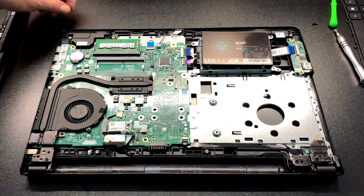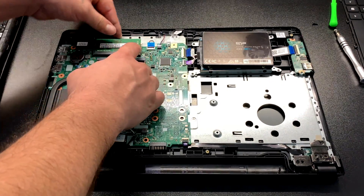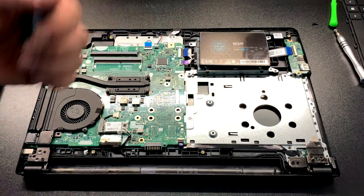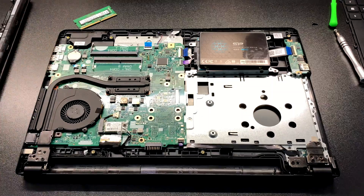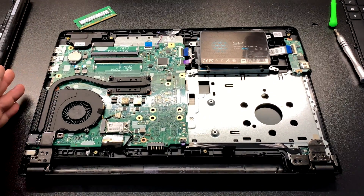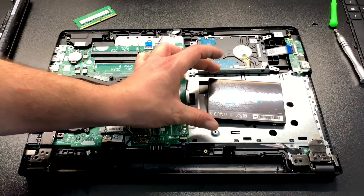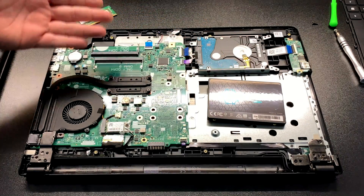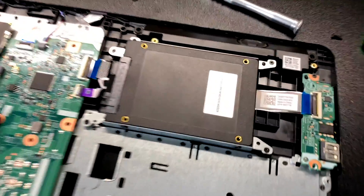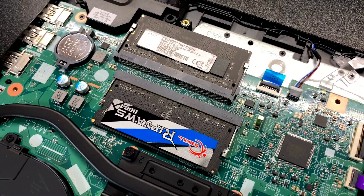For this I'm going to be using a cheap 240 gigabyte SSD that I got on Amazon — I'll leave links in the description. There are two DIMM slots in here but only a single four-gigabyte stick, as I expected. I'm also going to be changing the thermal paste on the heat sink — just going to pull it off, put some Thermal Grizzly on it, and put it all back together. Since this is a newer laptop I would normally just install Linux with RetroPie, but I planned this video to use Batocera, so I'm going to continue with it.